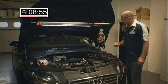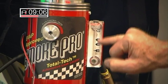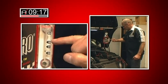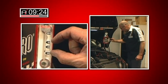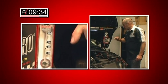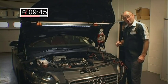We have a reasonable pressure — about 0.4, just under half a psi. That is a good result. When you see the manometer rising and falling, it's building up pressure and escaping past one or more open exhaust valves into the exhaust system, then building up pressure again — that is a good result. If the manometer ball occupies its movement between the centre portion of the manometer, that is a good result. Anything above that — if that ball were to rise consistently above that, whether you've got pressure drop or not — you have flow, and I would interpret that as an internal leak.